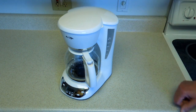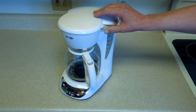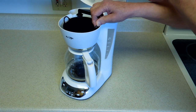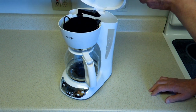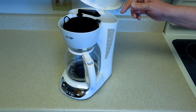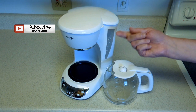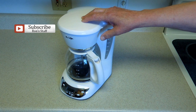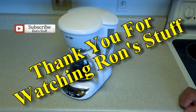This is a Mr. Coffee maker — I bought it a couple of days ago, about as simple a style as what anybody makes today. Unfortunately it still has this programmable controller on it. There's no gadget in the lid. This thing swings back and forth over the filter basket. The filter basket sits in here very solid — it engages. In fact, this is the exact same filter basket that was in my last coffee maker. There's nothing wrong with it — why change it? The basket has ribs in it, which increases the flow capacity of the paper filter. The valve on the bottom of the basket engages with the carafe. The carafe has a lid that fits. That pushes up on the valve on the bottom of the filter basket. This morning I put water in, put a filter and coffee in, turned it on and walked away. When I came back, I had 12 cups of coffee. I had no coffee on the counter. Imagine that.